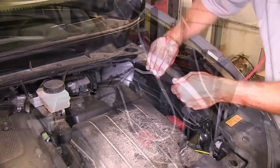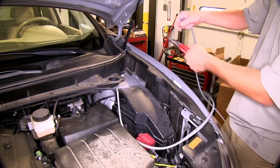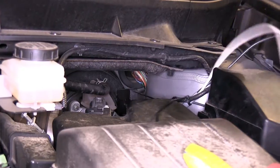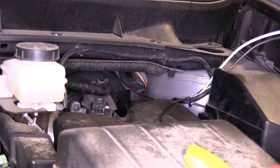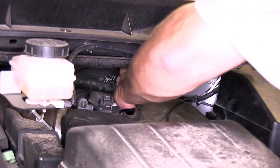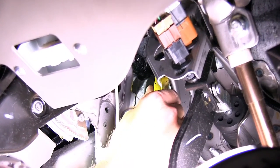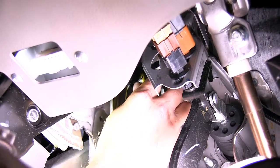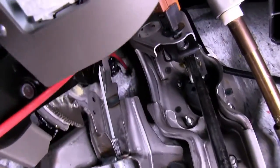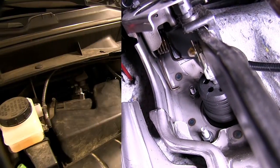Now we'll go ahead and take an approximate measurement on the length of wire and cut off any excess. The white wire will get routed into the cabin of the vehicle, and the black wire will stay in the engine compartment and be the power for our 7-pole connector. To route our white wire into the cabin, we'll need to make a hole into the manufacturer's grommet. Note on the inside of the firewall there's also some insulation that will have to be cut away. Once you cut away the insulation and use a utility knife to cut a slice into the grommet, we'll go ahead and use a red pull wire to assist with routing our wire into the cabin.